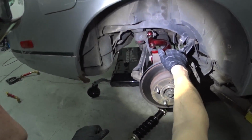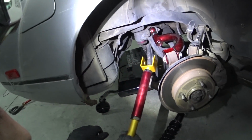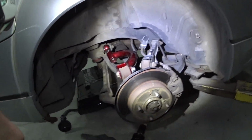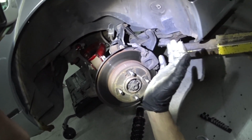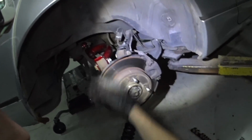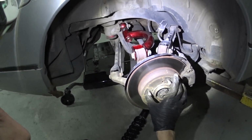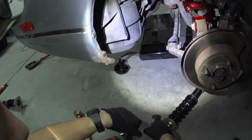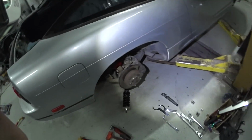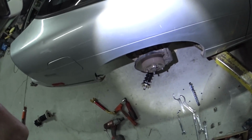So yeah, hopefully you guys could see now. Like I said, I got this arm right here, but I was gonna go ahead and get the camber dialed in before I install this. I didn't get the traction rod, which changes whether it toes in or toes out under compression. I didn't do that because pretty much everybody says to leave them stock length, so there's no real benefit of replacing that one, especially on a street car. But I definitely want to be able to take care of the camber and the toe. I want to take a little bit of the camber out, so I'm not wearing tires as much. You can see this one's almost flat and this one's almost new, so I definitely want to get some of that contact patch on the ground, because this thing just wants to spin anyhow and not go anywhere and do a bunch of sketchy stuff, especially with them other coilovers.